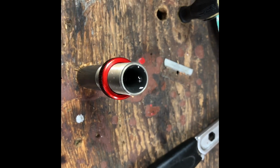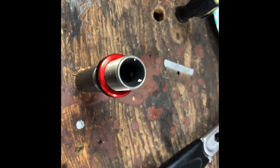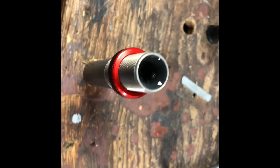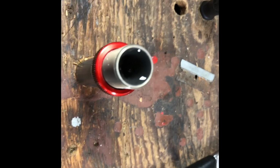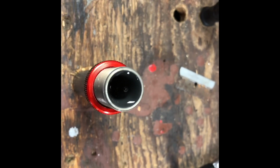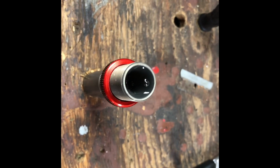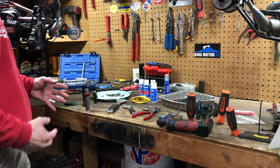I also reversed the piston to the bottom position after some fluid got underneath of it, and then I put the piston all the way down, and so that's the air pockets that are coming up. Little tiny air pockets. It just takes a little patience, and I'm gonna wait here until these quit coming, and then we'll get right back to assembling the shock. All right, we got all the air bubbles out of it. They quit coming up, guys.